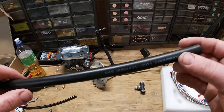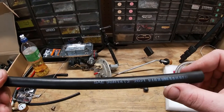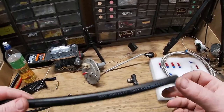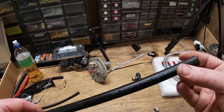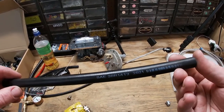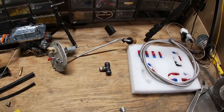Holley provides this 20-foot rubber hose for the return fuel. They do recommend that for any lines running underneath the truck along the frame rail, you use solid steel lines or hard line to prevent road hazards. Since they provided 20 feet of the rubber hose, I took advantage and used it for my return fuel. I had only ordered 16 feet of the Teflon line. The return should only see between 7 and 8 PSI, so nothing really high pressure. I probably could have gotten away with regular 3/8 inside-diameter fuel hose, but since they provided it, I used it. I used the rubber for the return and the Teflon for the primary feed.